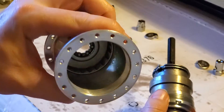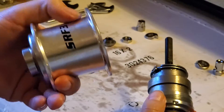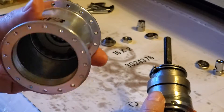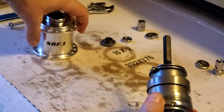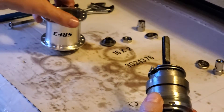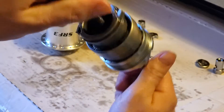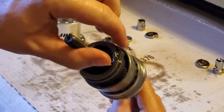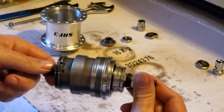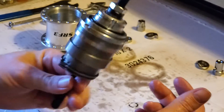Inside you'll see it has a ratchet ring with 20 points of engagement, which gives a little bit more responsiveness in the pedaling versus the older AW. Here's the cartridge — the cartridge is actually a little simpler. These pawls can't just fall off; there's a circlip hole in them. And it does physically look different than the AW.